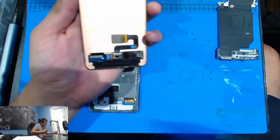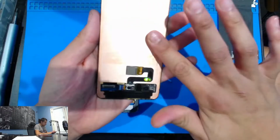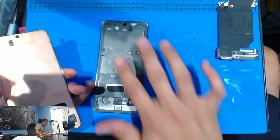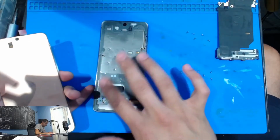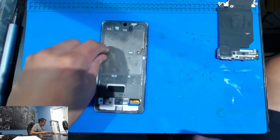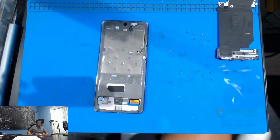Careful, careful. All right, this doesn't have adhesive, so we're going to, this has some here. And guys, Samsungs usually come with a pre-cut adhesive. I didn't see it in the box until after, so I ended up just using dual-sided tape with some B7000, which even with that pre-cut adhesive, I still use some B7000. So we're gonna use a combination of double-sided tape along with some B7000.